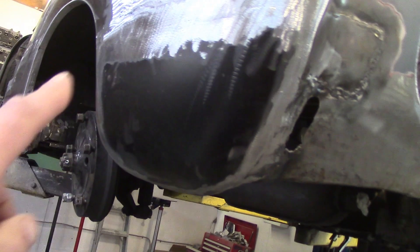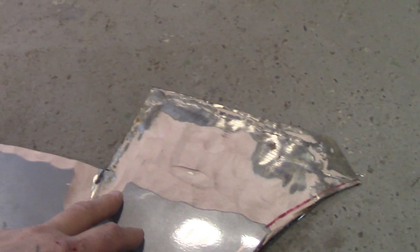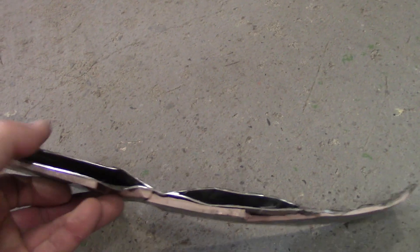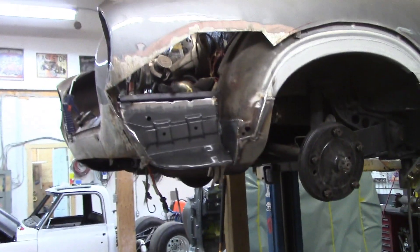The problem is up in here it just never ends. There's a patch right there, but they don't make a patch above that area. On this side it's just gone all the way - we've got to fabricate it. This upper piece has a half-inch to inch thick of bondo where someone smashed the metal in and welded another patch over top. All that material is going between the layers and just rusting. This piece is actually three layers of metal - look how thick the bondo is.